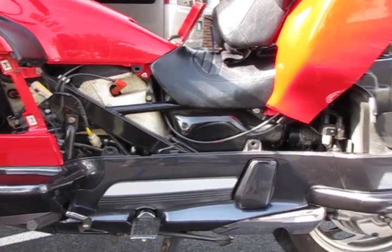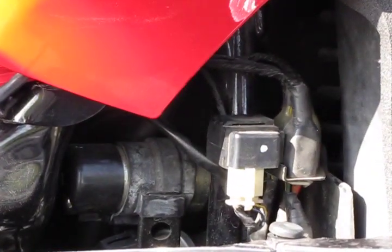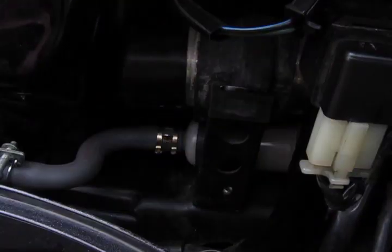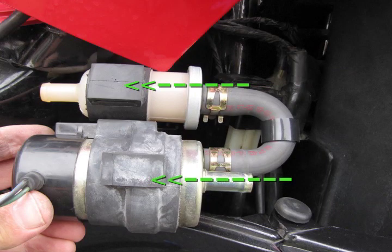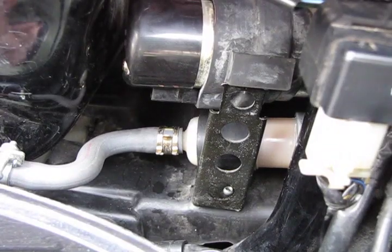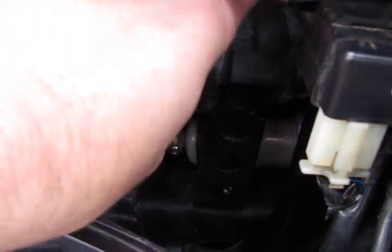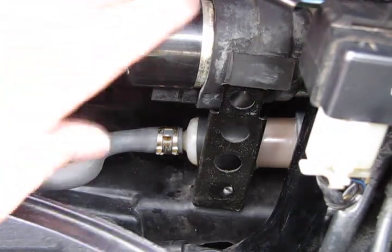Now back here on the left-hand side and under the front of the trunk is the fuel pump and the fuel filter. Both the fuel filter and the fuel pump have a rubber strap around them that allows them to be suspended on a metal post, and this allows them to just be lifted out. Here I'm lifting the fuel pump off of the post, giving me more room to get at the fuel filter, which is on the bottom.